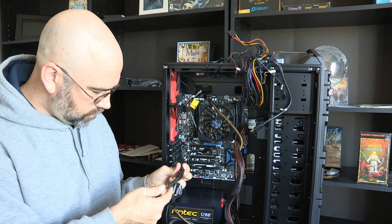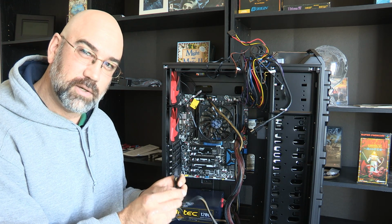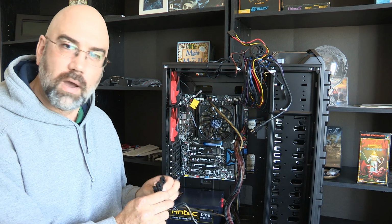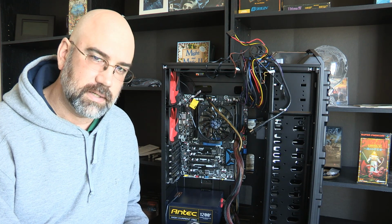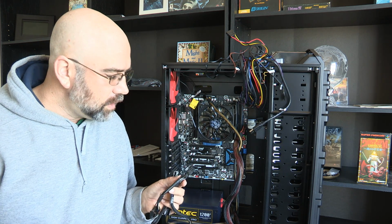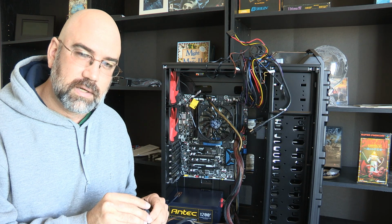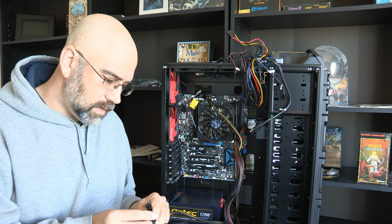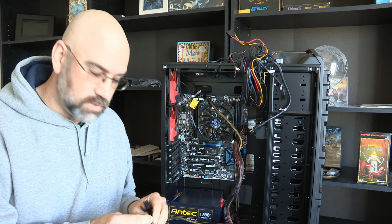Wow, damn. Okay, so I could do, with this power supply, I could do quad. Could I do quad? No. It looks like, okay, so on my 570, my GTX 570, which some of you asked me why I chose a GTX 570 video card for this machine, and it has to do with the fact that I already had it. So it's PCIe 2, and I needed that to fit into my old machine, because that was as high as it could go. This is PCIe 3, but I believe it'll work in here no problem, and I'll be pretty surprised if it doesn't. That'd be horrible. I actually didn't look to see if they were backward compatible, I just assumed.